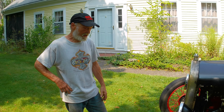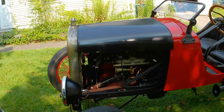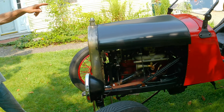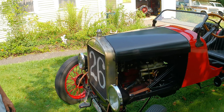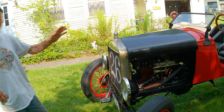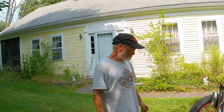I ran mine through three half-inch plumbing pipes from 2008 until about a week ago, went through three carburetors, and I think I've got it running right now. I'm looking for a 1928–29 Chevy carburetor. The fuel pump is underneath the frame — you can't see it — and a toggle switch runs it. The colder the gas is the faster she's gonna go — that's my theory. You go to the drags long enough you see them putting ice on it; colder air holds more oxygen, stronger explosion, faster car.